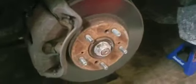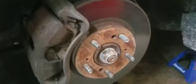I'm gonna take the wheel off, start pulling the spindle off, give you guys little hints, how I like to take them off. Simple stuff, it's not too hard at all. See you in a bit. Alright, now I got the wheel and all the hardware off. I'm going to take off the axle nut, caliper, cut these zip ties off the ABS line, take this top ball joint loose, get both lower ball joints loose, pull the spindle off. Too easy.